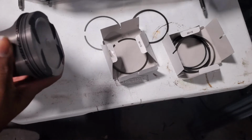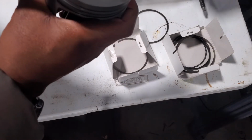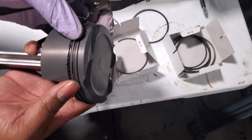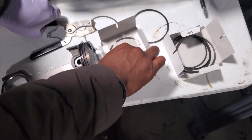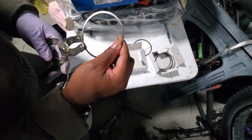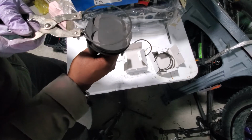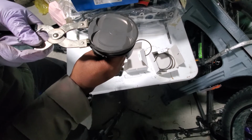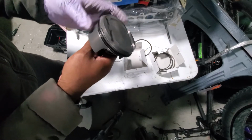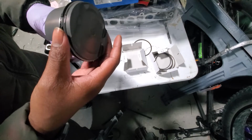So I'm gonna put it on. It needs to be number side up. You see the number right there, barely. It needs to be number side up for the second ring. And we're going to find it. Same method. Back you up here all the way. Numbers up. Numbers should all be facing up according to them. Go to top ring, and we work it into its home. So there you go. Rings are installed. No damage to my pistons.